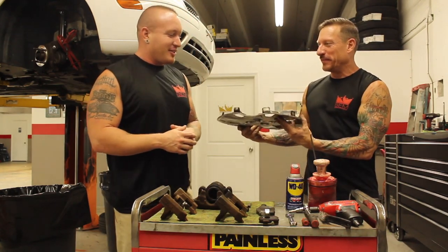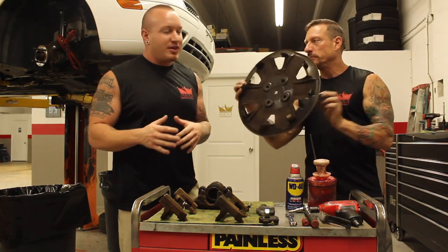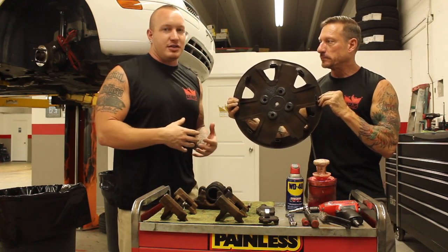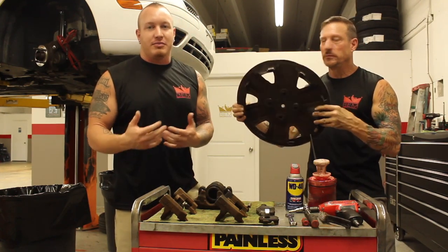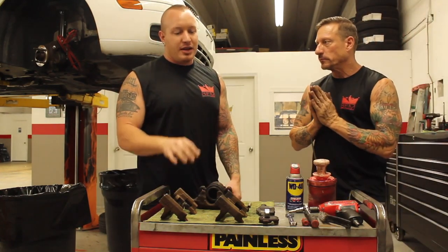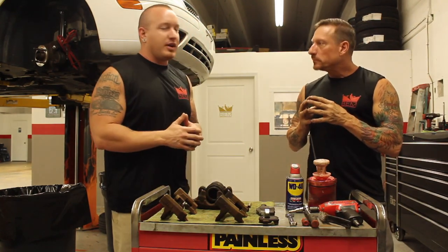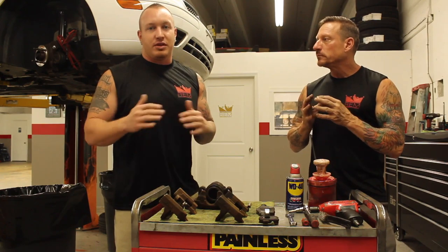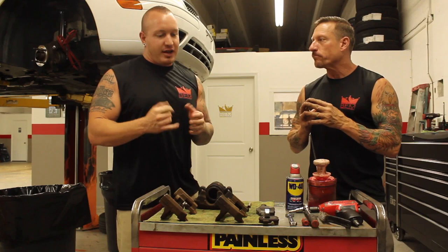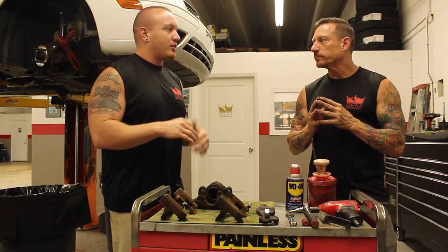That's actually a true sign of a problem, either in a hub bearing assembly or in some part of your brake system. That causes that much heat to generate — typically a sign of something either failing bearing-related or something locking up from a brake-related standpoint. And that's exactly what we had happen. Left front caliper locked out on this thing. So we did go ahead and tear this thing all the way down. It's going to be a true start-to-finish rebuild of the entire front brake system, which includes the rotor, the caliper, the pads, the mounting brackets, the slide pins, the hardware, and the flexible hoses as well, since these things are that old.